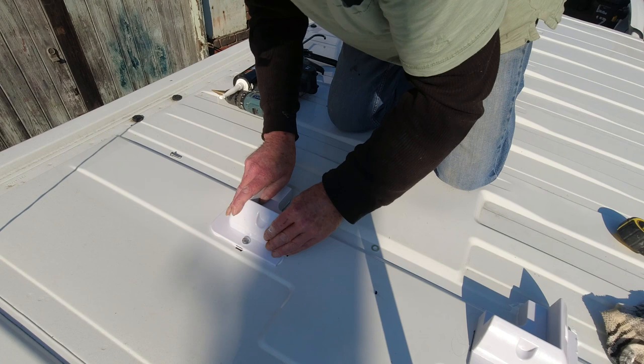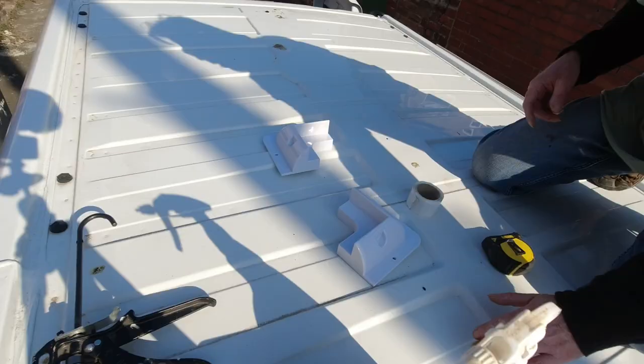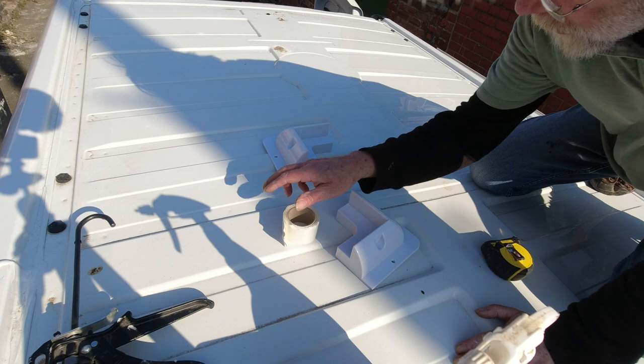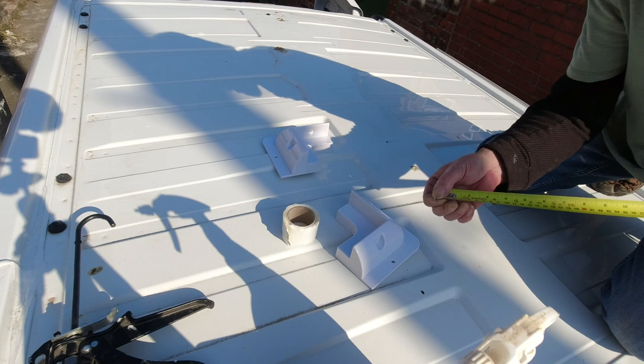We'll push that down. I've placed this one on — we're in a slightly different position, not on a full rib here but just on this piece of the rib. I've found some caravan skylight sealant stuff, and a couple of layers of that underneath may just pull this up a bit to help the Sikaflex to adhere. I'm now measuring this front one from the side of the van — that's 51 centimeters.